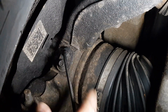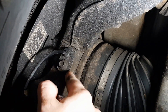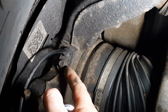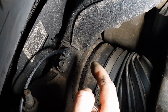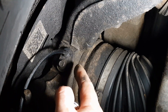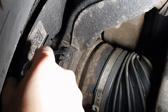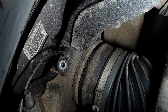The sensor is now hanging free — you need to remove this bolt here, and once that's done this whole thing should just move out of place. Just be aware that this has got dirt, mud, and muck on it and it will on yours too, so the chances are it's going to be a little bit seized in. The new sensor housing is plastic, as will this one be, so I'm thinking not to wiggle it too much — I don't want to break it and leave the sensor in the cast itself. Let's get the bolt removed. Again, retain the pin for the future.